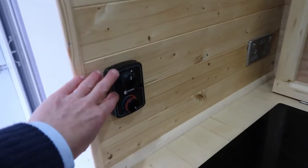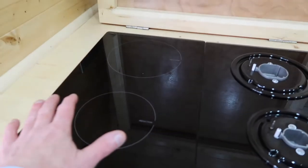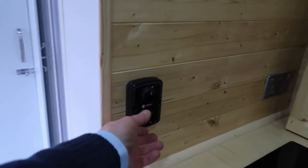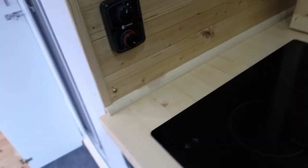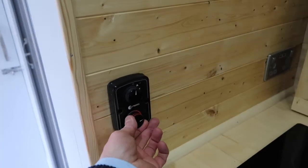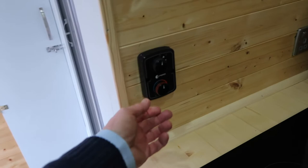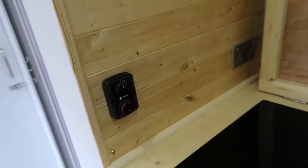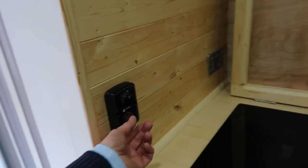We've got the control for the Propex heater here. I thought it was far enough away from the cooking surfaces, and this Propex heater, what I find is that you will probably have it on full most of the time, except when you went to sleep, and then you might turn it down to halfway so that the boiler would kick off, otherwise the heater will go full all night,